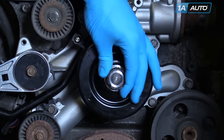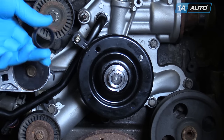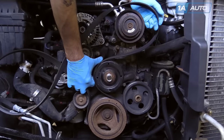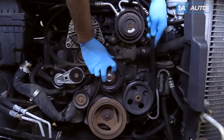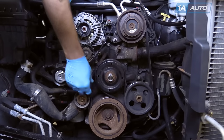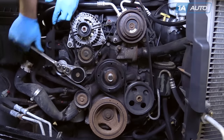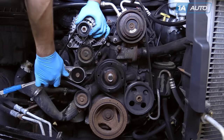Many of these parts are packaged with a little plastic sheath to protect the threads of the radiator fan — make sure you remove that before trying to install. Loop your belt around your crankshaft pulley, over the water pump pulley, under the power steering pump pulley, over the AC compressor, under your upper idler pulley. To the other side, go over your lower idler pulley and around your tensioner. Using your 3/8 ratchet, remove the tension from the tensioner pulley and install the belt over the top of your alternator pulley.